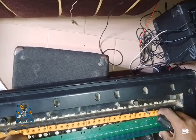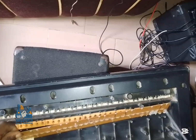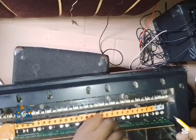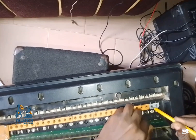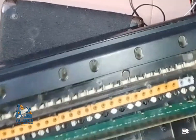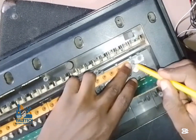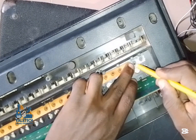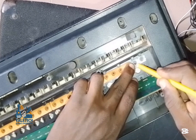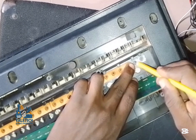If you have a brush you can just clean it. Let's clean this side. The one that is fading is this one — that is number 2. You can take your pencil, go to it, that's the number 2 there. Just rub it at the tip. You can see me rubbing the edge with my pencil because the conductive coating is fading.